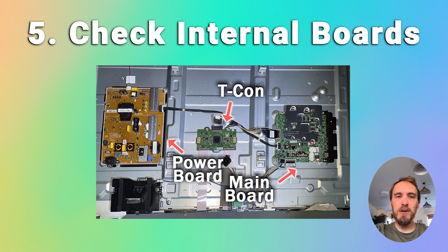The first step is just to make sure that all of the internal cables are tightly seated. Unplug your TV and drain the power — wait for half an hour or so, because the capacitors can hold charge for quite a while and you don't want to give yourself a shock. Then unplug all the cables, give all the connectors and cables themselves a clean, and try carefully reseating all of the cables, then power up your TV and see if the problem is still there.